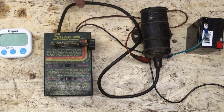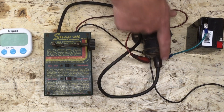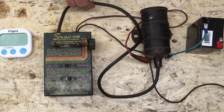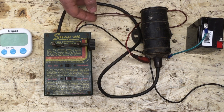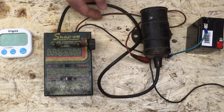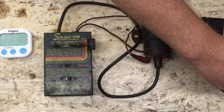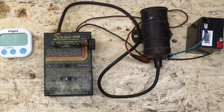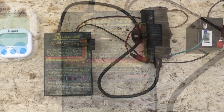So the way this is wired up, you've got three wires here. First you've got your high-tension wire going into the high-tension plug on the coil. Then you've got your direct power. Remember the Model A is 6-volt positive ground, so my negative is flowing into the coil. And then I've got what would come from the ignition to provide power here — that's the red line coming in. And then lastly I've got a ground. This all isn't really active until I hook up the ground, so I'm going to do that now — you may see a little spark. Okay, so now the system is live.